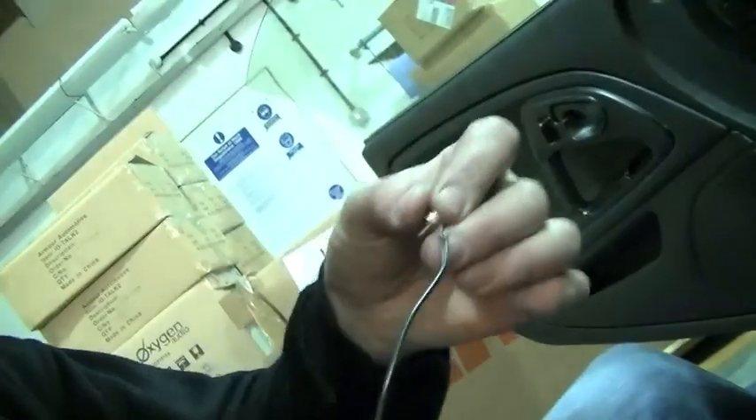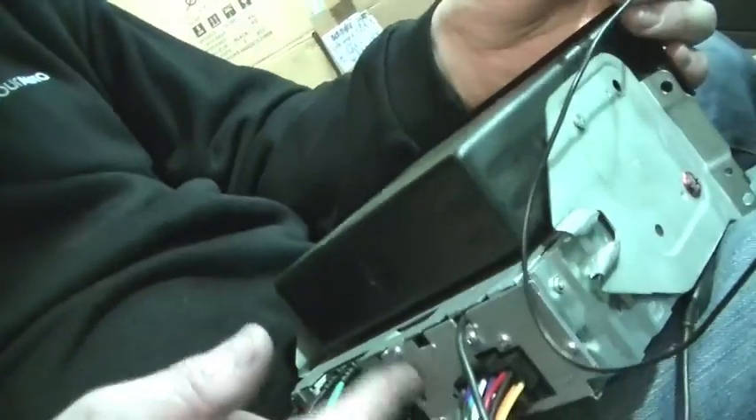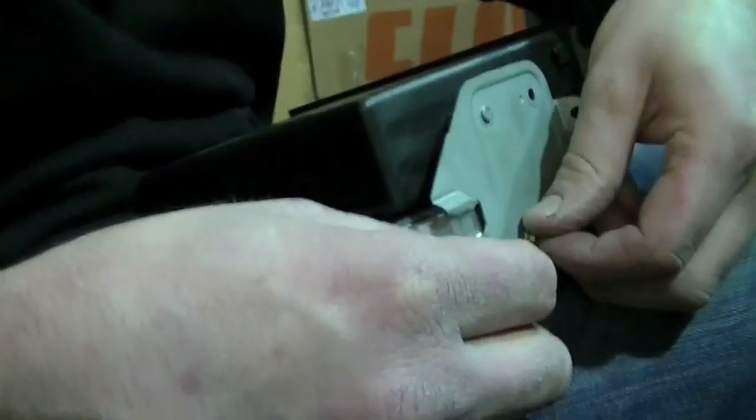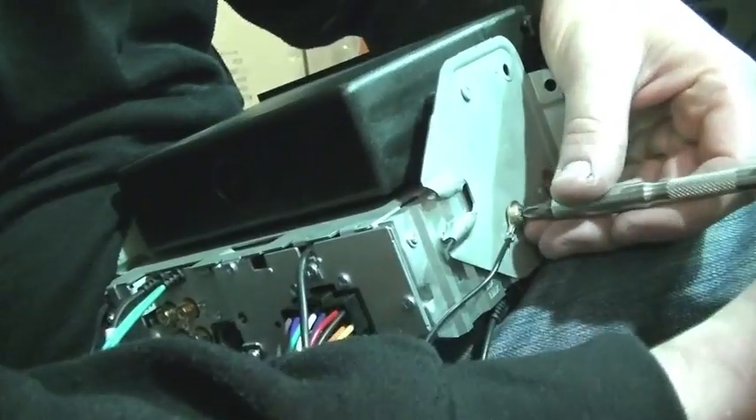And that's just the Earth. They don't have an Earth on the radio — they pull the Earth normally through either the chassis bolt on the radio or the airway. But where we're pulling a lot more power through than the stereo, we always put in our own Earth, otherwise you get interference and a whizzing noise.